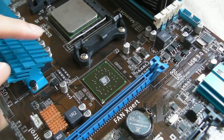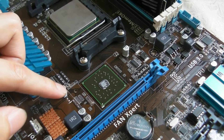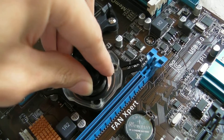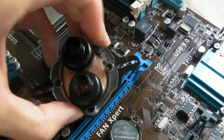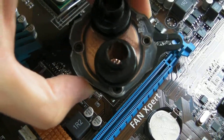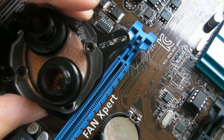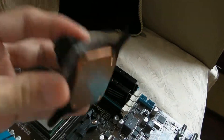One of the things — when I try to put the North Bridge water block on, I discover that it's not going to fit. Even if I sort out this extra section, the other side is still hitting the capacitor. And even if I sort out both sides, it's still going to hit the PCI Express, unless I maybe cut out a portion of the PCI Express port. So this water block — no good.